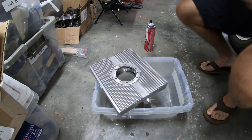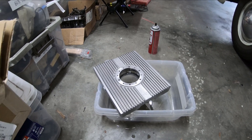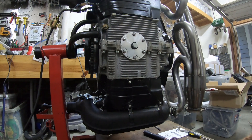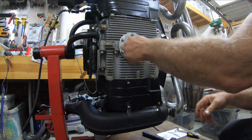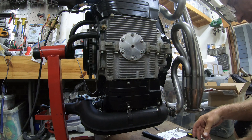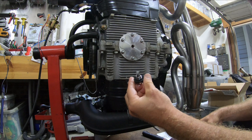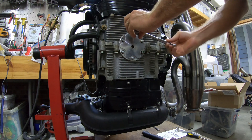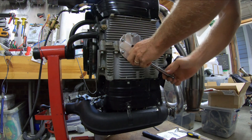I'm just gonna set it there and let that dry out. Then next step, take this thing off. So you got this one — this is the big one. It somehow came with a rubber washer, but I'm gonna use the copper. When I get this onto the deep sump, this will still be my cap. You can see this is a magnetic drain plug, but I use a copper one — it's got a little magnet on it. So I can bring the crush washers and new gasket set, so that will all just get scrapped.